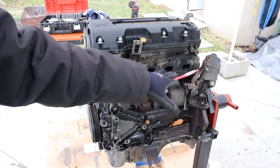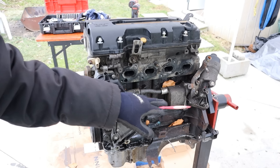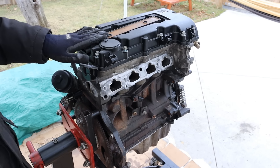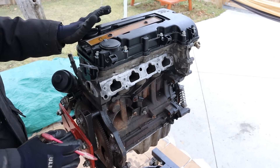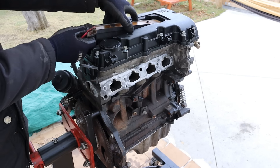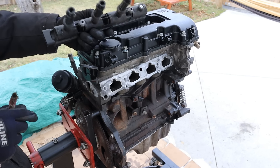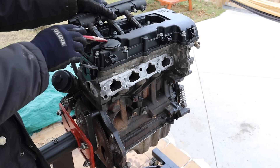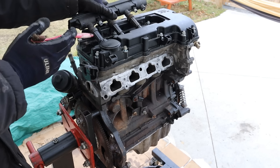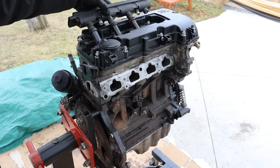Now the turbocharger is going to sit up at the front here. This is a transversely mounted engine and the intake side is on the back. You'll see this is the intake port — the intake plenum would sit on here and those were known to be a little problematic. We do have one giant coil on the top here that powers all four cylinders, which will be a little bit more expensive to replace individually. And at the top here, we've got an integrated PCV diaphragm, which are also known to fail, and that's the reason why these valve covers get replaced so often.